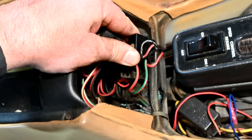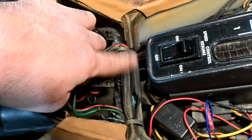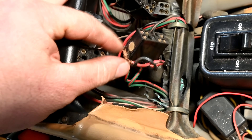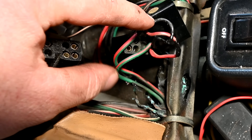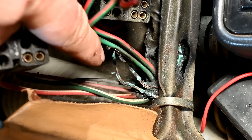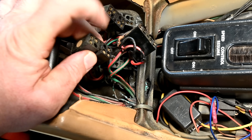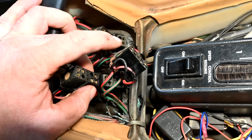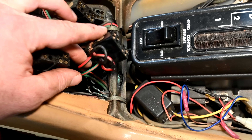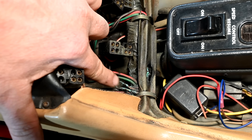Here's the connector for the master switch — got it. Here's a closer look with that cover out of the way. Here's the switch for the right front where we have the damage. I thought this was a metal bracket they were rubbing against, but it's plastic — and it's actually broken on one side. These wires were rubbing against this plastic edge right here. Throughout the years of vibration they probably just kept rubbing, the insulation wore out, and they shorted. Here's what's remaining of those two wires.